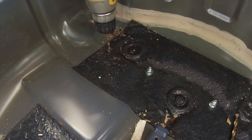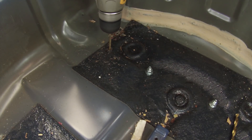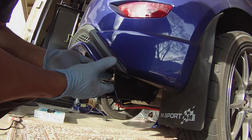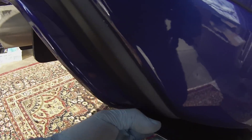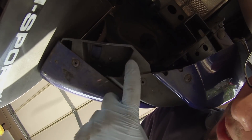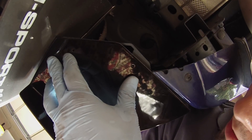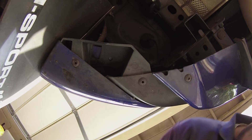We're gonna drill some more holes for the side pieces. With these side ones, you've got two holes here — you want this piece pointed down, and it's gonna be going something like this where it's flush there. It will actually be holding the mud flap in place. Let me show you underneath where we're gonna put our self-tapping screws — piece of plastic, two little holes. Line it up pretty dang good — that's where we're gonna be mounting that, for both sides.